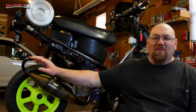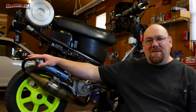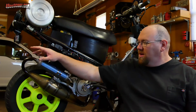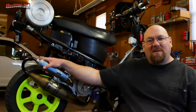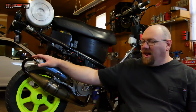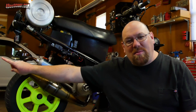So you'd be better off with a rear exit exhaust if you're looking for something that's easy on your ears for long-term cruising or something like that, day-to-day use. Which pretty much with this style of exhaust means you're either going to have something modified with a Penton style muffler like the Peace Pipe has, or you're going to have to buy a drag pipe, which is where instead of this bend here, it goes straight out the back.